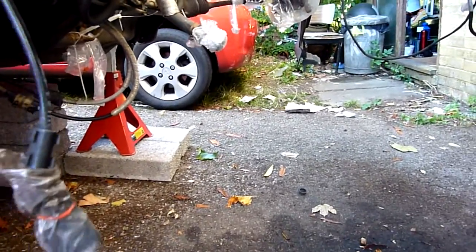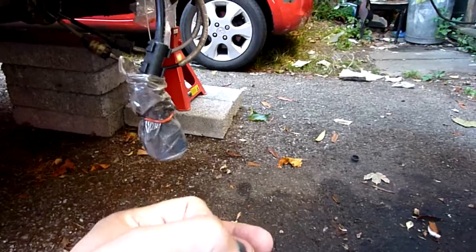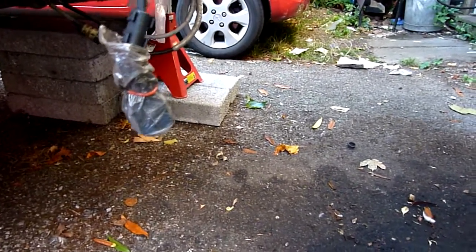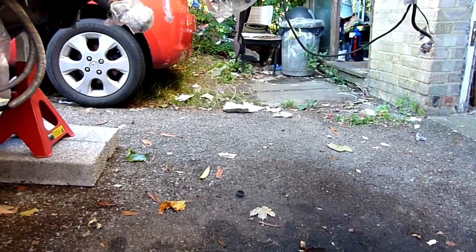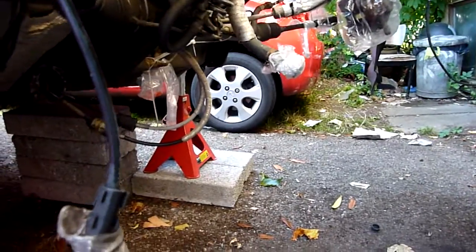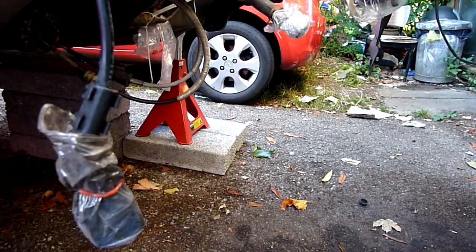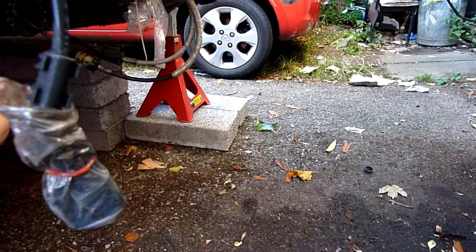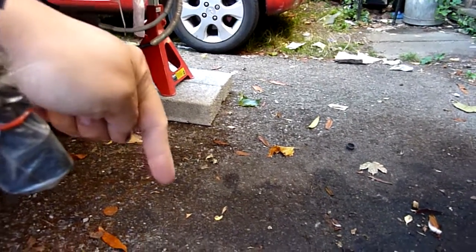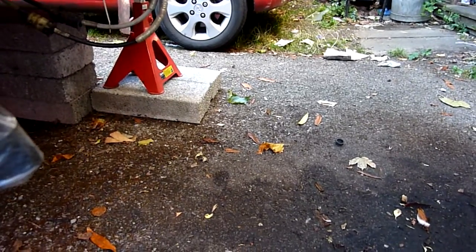All the suspension hangs on it, and unlike usual, when you've got a ball joint at the bottom here, you can just pry bar it, it'll pop out. That's not possible with this design. What you got to do is go through, disconnect the whole load of pipes, drop the subframe down at least 150 millimeters, 15 centimeters, and then once you drop the subframe, you can. There's a bolt at the back of the A-frame or the wishbone that goes in downwards, which is daft. If I did it in that way, it would have no problems. That's the difficult bit.